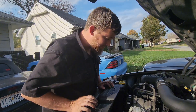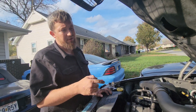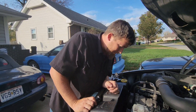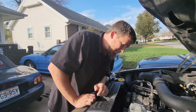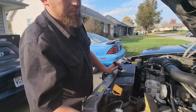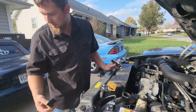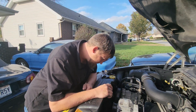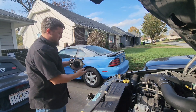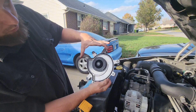I need to go get some stuff to clean that off. I'm going to use scotch-brite — be careful with steel wool, it might leave fibers in there. I also used some carb cleaner and one of those little paint detail sanding discs from AutoZone, 2000 grit. That was the easiest thing to get down in there. Not perfect, but for what it is it doesn't need to be any better.